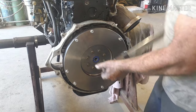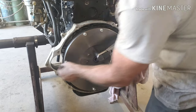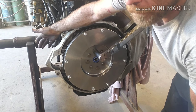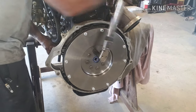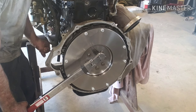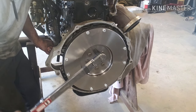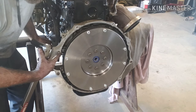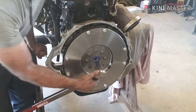When you're torquing this down, just go ahead and torque it down like you're doing a tire on your car. We're going to have to lock it up so it can't move. There are a couple different ways to do that — I've been able to use a flathead screwdriver as leverage. Got my flathead, come right here through the starter port and just grab a tooth. Go around in a star pattern, holding it through the starter hole and torque all of them down. After you torque one, mark it with a paint marker, then move to the next one — that way you know everything's torqued down.